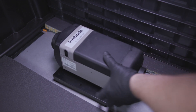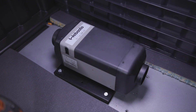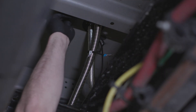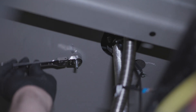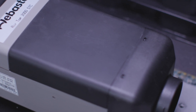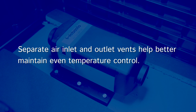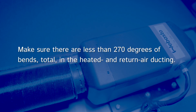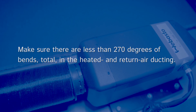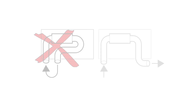You'll need an extra set of hands to help tighten the bolts. Be sure to understand the guidelines for exhaust routing and length found in the installation manual. In some cases, the exhaust pipe may need to be trimmed for proper positioning. Ducting is provided to run warm air into your bunk space. Separate air inlet and outlet vents to help better maintain even temperature control. Also, make sure there are less than 270 degrees of bends total in the heated and return air ducting. Too many bends reduce airflow and will cause the heater to overheat and shut down.